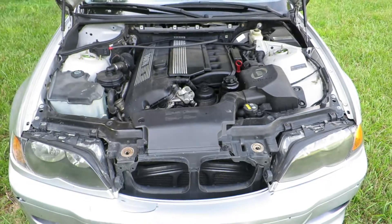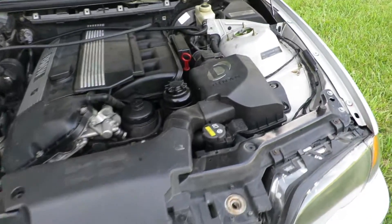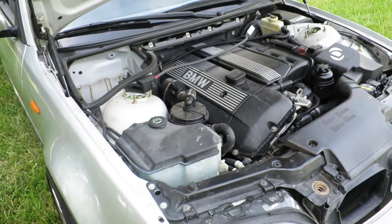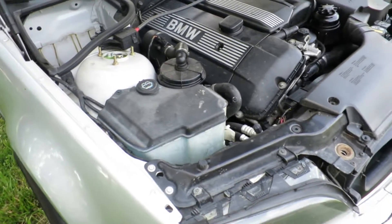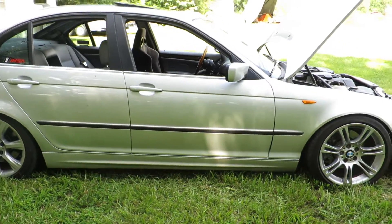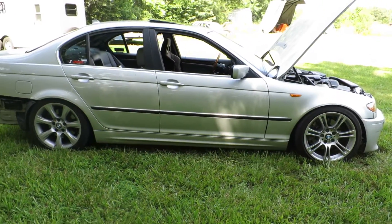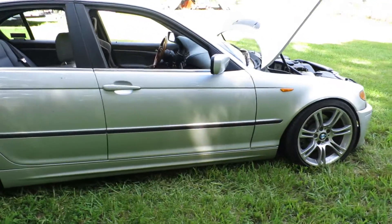Let's move on to the engine. The engine is pretty much stock — no tune, nothing. I just have the Dinan intake, got that through work for a good deal. Probably the most important mod if you want to make more power on these engines: catless headers. I got these for $101 shipped to my door — they're DNA Motoring, which I know sponsored an FD team at some point. They fit great, never had an issue, not leaking, and I've had them on for well over 30–40,000 miles. The car dynoed at 208 wheel horsepower and 214 foot-pounds, which is pretty solid, especially given no tune.